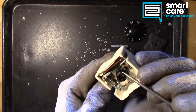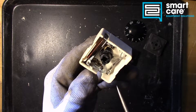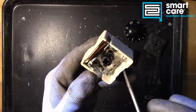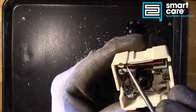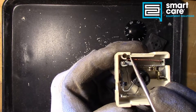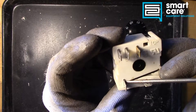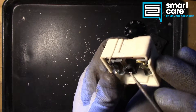So it's acting as a timer — it's entirely built around heating up and cooling down. As a result, this is not a thermostat. It does not know the temperature that it's controlling; it's really just acting as a timer. There's a very small whisker of a wire that runs down through the back of the case and along a black channel back over to H1, and that's how we're completing our circuit. One side of the heating circuit is attached at H2, and the other side runs through that black channel over to H1.